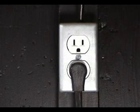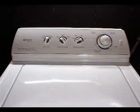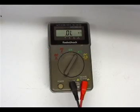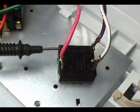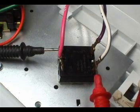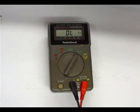Make sure the washer is disconnected from the wall outlet before proceeding. Set the water temperature switch on warm and open the controls panel. Set your multimeter to read ohms. Disconnect the orange wire from the switch. Take a reading between the terminal of the orange wire and the terminal with the purple wire, and take another reading between the terminal of the orange wire and the terminal with the white-blue wire. The two readings should be close to zero ohms. If either reading is infinity, the water temperature switch is bad and you need to replace it.